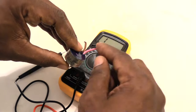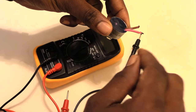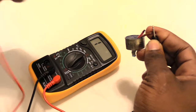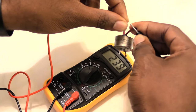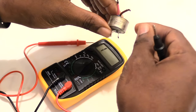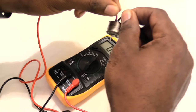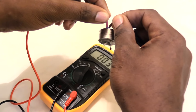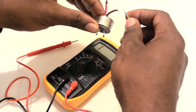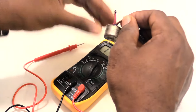Now I should get a signal. I've taken this thermostat and put it in the freezer to cool it off, and now that it's cold you should see that it has continuity — the signal runs all the way through. See how it's running through? That's because this thermostat is now below the temperature needed for the circuit inside to close. When you get continuity like that, it means the circuit is closed, and inside your freezer that means your evaporator is coming on to defrost.